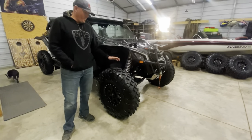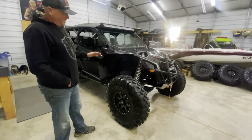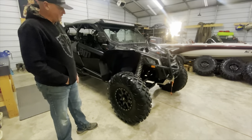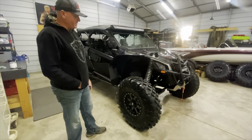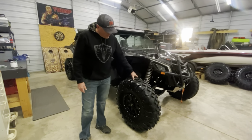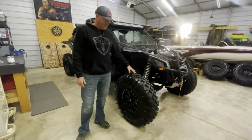I went with a 34-10-15, so this is a 34-inch tall tire. I like it - it looks sweet. I think that's what this machine needs; it looks better with a taller tire. I've got it on there now with about 12-13 pounds of air and it measures about 33 and a half, so it's a little low but not bad. The price on them is really good compared to Carnivores and System 3s. I'll put a link in the description.